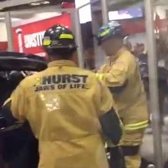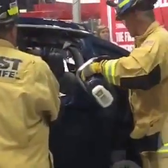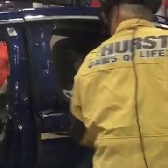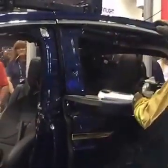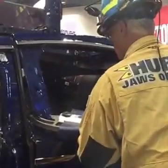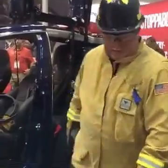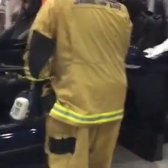Larry's finishing up the cuts to remove that lower section of door from the upper section. Notice the sounds the aluminum makes — it's different than what you're used to hearing with conventional steel construction. Aluminum doesn't tend to cut like our steel does; instead, it breaks. That's the cracking noise you're hearing when they're cutting through this or breaking it with the spreaders. The top section of the Falcon Wing door has a high-tension spring, so it has a tendency to fly open when separated from the bottom. That's why Tim maintained control of that top section so it didn't break free and create a hazard for rescuers.